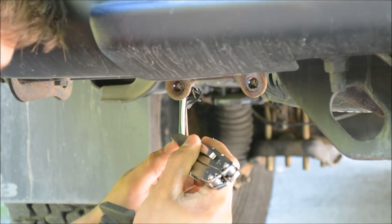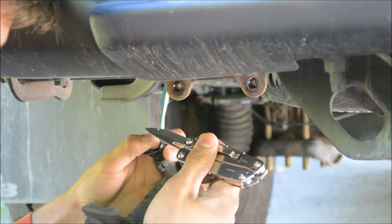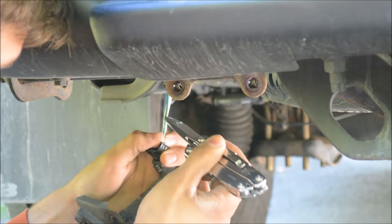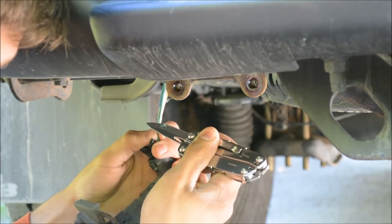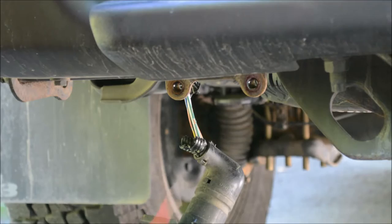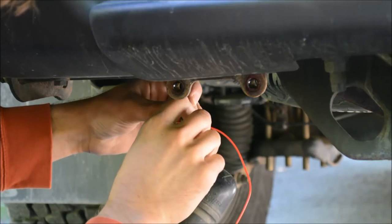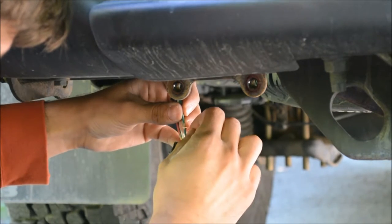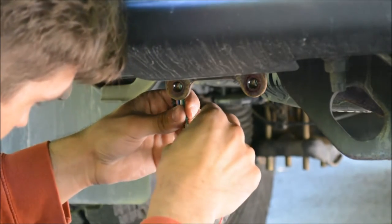What I like to do is use a very sharp knife and gradually shave into the insulation of the wire until the wire strands become visible — carefully, because you don't want to damage the strands. First I'm going to do the tail lights, which are the running lights. I'm going to take my very sharp knife and get this — which is the green wire, by the way — and begin to shave away the insulation until I can start to see the wire strands and get a good enough cross section.